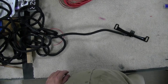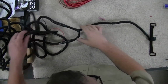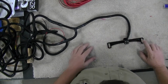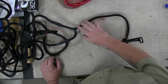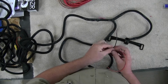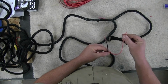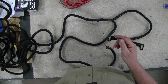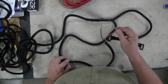All right, long story short, we're over here at the bench in the RATTLECAN Guitar Restorations area, just so that I could use the Uppy Cam and show you what I have done. This is my license plate backup camera mount, and so I have a wire that is going through this split loom that then goes to here. This is the power wire for the backup camera. I have also run another wire because I need a trigger wire that will tell the radio I'm in reverse, put the reverse camera up on the screen, and that's what this is.